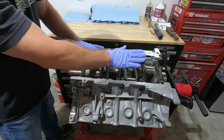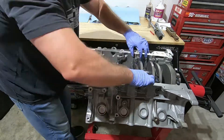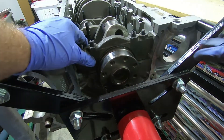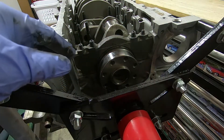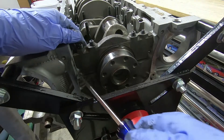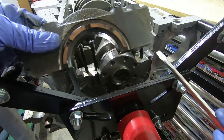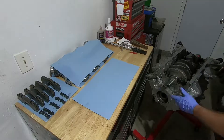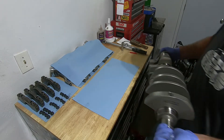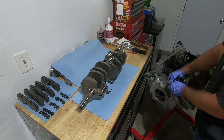To make it easier to grind the clearance for the rods, I'm going to go ahead and remove the crankshaft. Most of the time you can get these main caps by pulling up and wiggling at the same time. But if you have one that has a hard time, there's some gaps on the side — not the machine surfaces, but a little air gap over here. You can get a little screwdriver in there and just kind of work it up nice and gently. With your crankshaft out of here, you want to be careful not to nick your main studs.